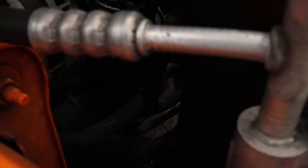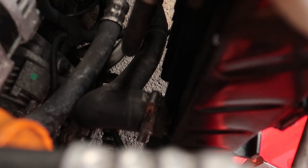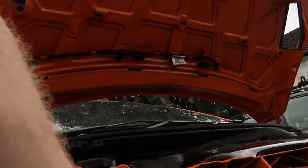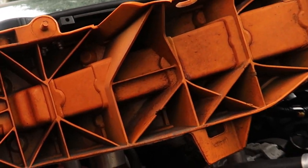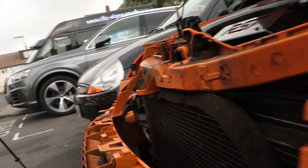I'm going to undo that coolant hose pipe there and drain it into this bucket, then start taking off the AC condenser, the rad, ECU, induction kit and so on. Sam's arrived — we're trying to take off the front end. You've got one bolt in there, one down here, these four crash bar bolts — you've got to scoop it out to get it out. Just move all these wires and everything clipped in behind here. I'll set up the camera and timelapse that bit.